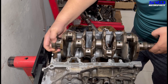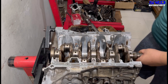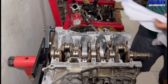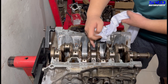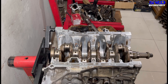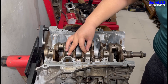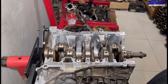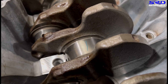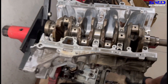We make sure we can measure the oil clearances of this high-mileage motor - this is a B20 CRV engine. We drop in the thrust washers just to minimize any movement of the crank. We wipe off the number three journals because we're going to use number three to demonstrate. We cut about the width of the journal - not too short or too long - and here's how it sits on the journal, positioned across the journal, not lengthwise. Here's the reference strip that comes with the plastigage.